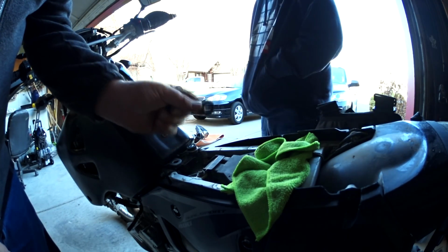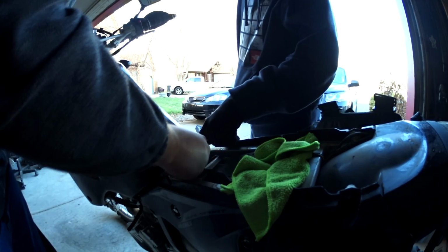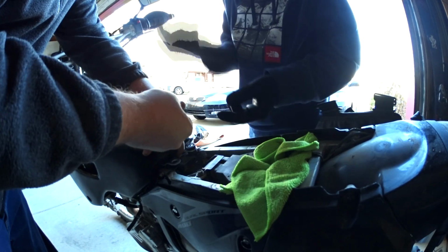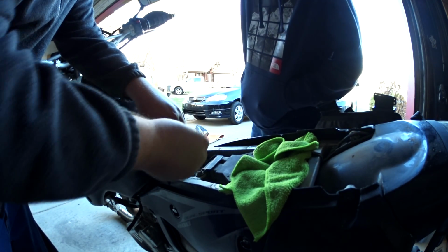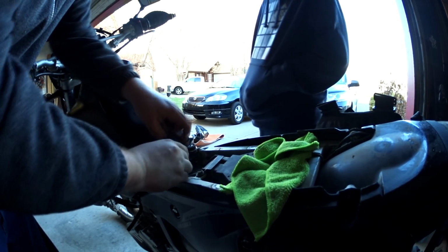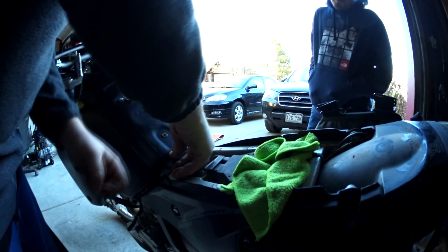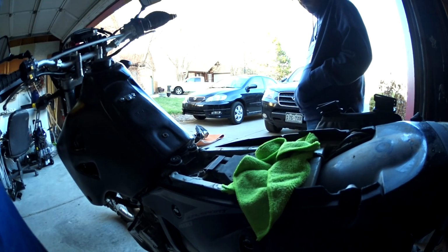Then off of the original tank, there's one of these little grommets. Goes underneath. Make sure you have it set up right. You want the cavity to be facing up. Oh, you got it backwards. Flip it. So it crushes down. So you fit that in there, and then you pop that guy through it. Just like that. And then blam.